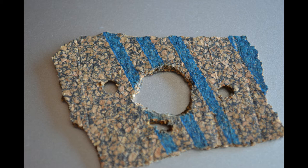So when you have those two screws holding the gasket in place, for that bottom hole, you're going to have to kind of wing it. Take a drill bit that's something like 3/32, and you're going to have to feel for the hole, but eventually punch the hole through the gasket material. When you do that, be careful not to push it so far that you can't remove that gasket material out of the hole of the carburetor. You obviously don't want that in there to end up clogging the passages one way or another.